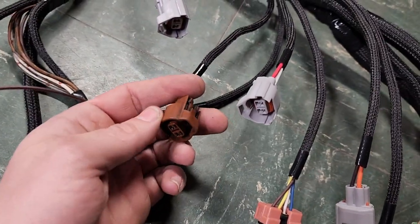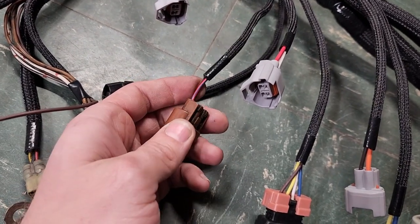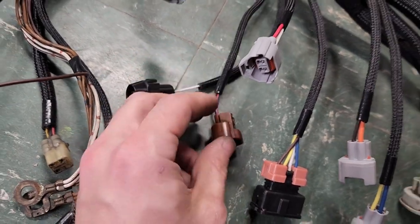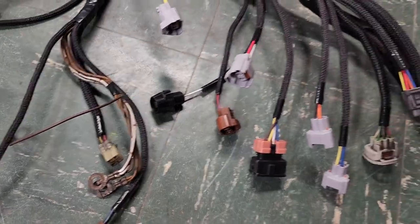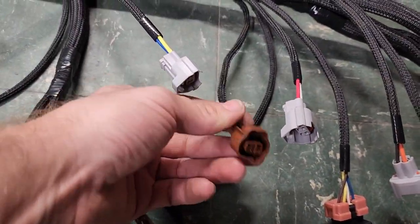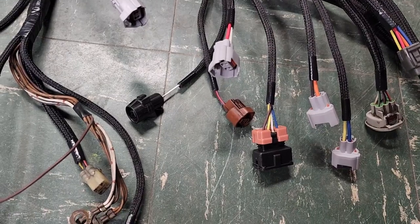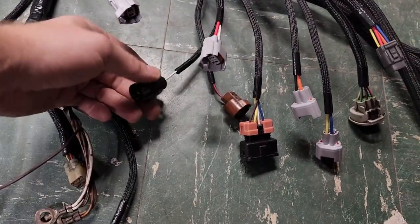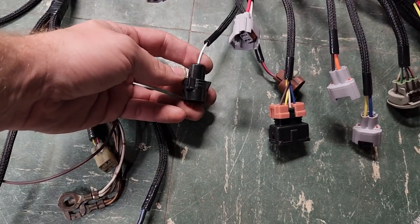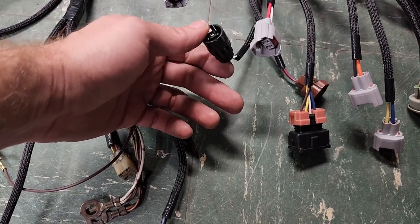This is the fuel pressure bump VSV — the factory fuel system uses a VSV to give the fuel pressure a little bump. It's a brown connector with a keyway, towards the front of the engine. That connector is common through all years. The knock sensor connector, however, changed in a select handful of 1992 cars to the JZ-style connector, so if you have a '92 harness, that may be different.